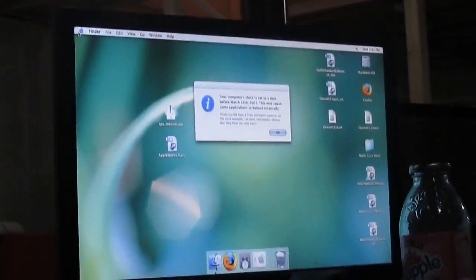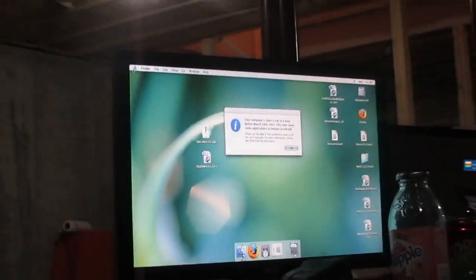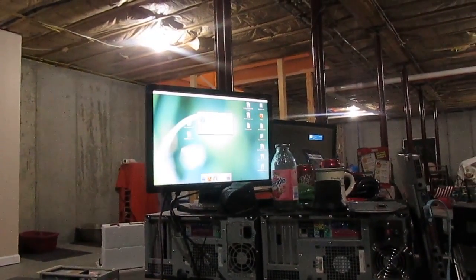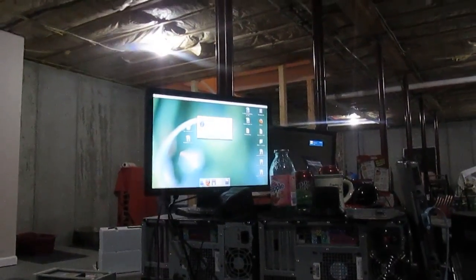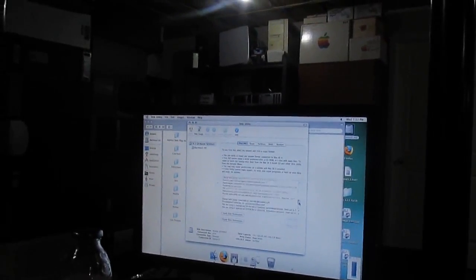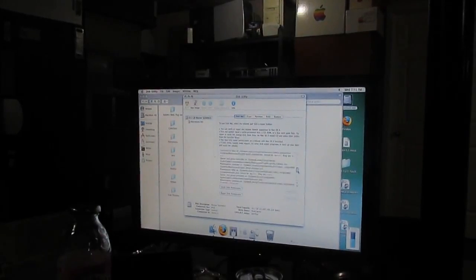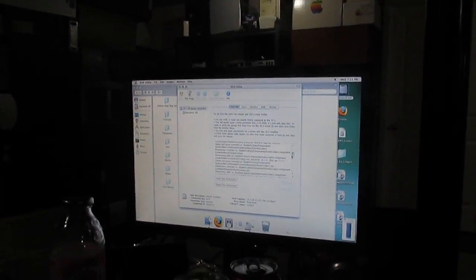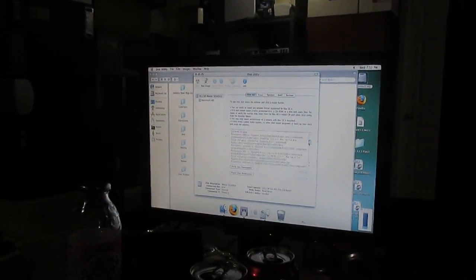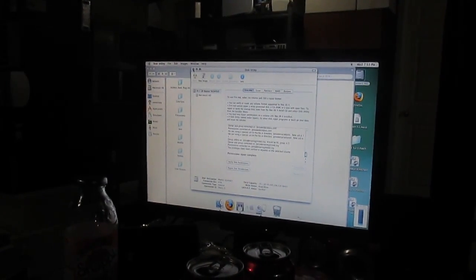I'm gonna do me some exploration of the system folder here, see if I can see anything erroneous. Maybe do a little bit of checking of audio related things, because that's what's appearing in the kernel panic. We'll see. So, just for shits and giggles, I didn't think it would really work, and it might not, but I did a permissions repair on the drive, and I actually found quite a bit of stuff, and a lot of it is related to audio, which was mentioned in the kernel panic. They might be completely unrelated, but, yeah, it's worth taking a look at anyway.